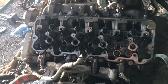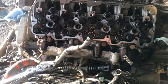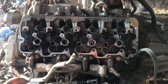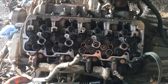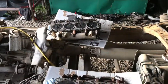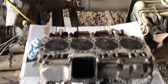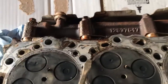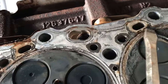Back to the engine — ready to pull this head off, loosening all those head bolts. Not expecting too much underneath since I already found what I'm pretty sure is our leaky gasket over there, but we'll see if there's something else too. Both heads are off now, laying on the cardboard box. Had another spot on this gasket here that looked like it could have been blown — you can see it in the head, it's rusted right there, another spot right there.